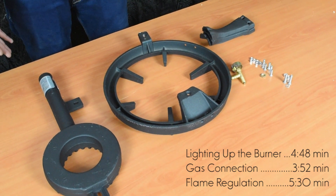In order to connect the gas appliance to the gas supply, all you need to do is get a rubber hose, a gas cylinder, and a jubilee clip. You connect it by putting it on the brass outlet all the way in, and then tighten the connection with the jubilee clip.